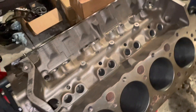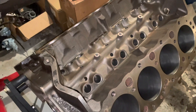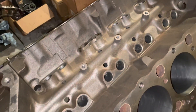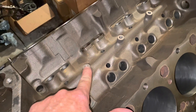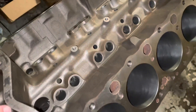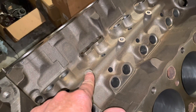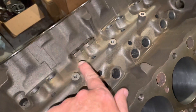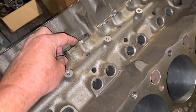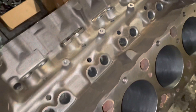One other feature I forgot to mention when converting a car-truck engine to a marine engine: you want to look for a block or engine after 1987. This block is after 1987, and I can tell because it has these three bosses here. This is a 305 block — the 350s have the same bosses. The purpose of these bosses is to hold down what's called a spider — a metal device that reaches over and holds down the lifter retainer. The spider is a metal bar that presses down here and keeps it from coming loose or flying away.